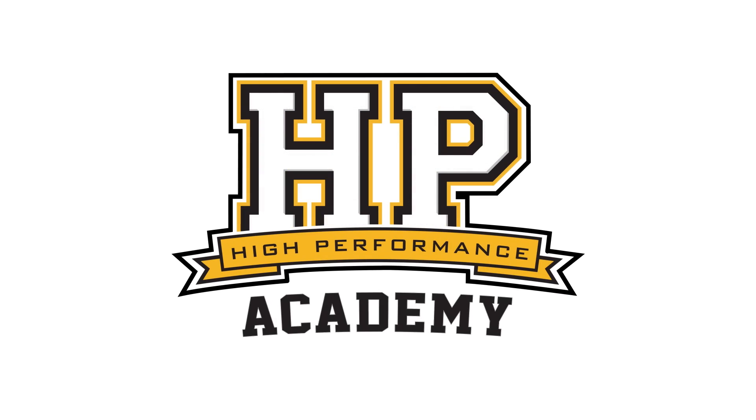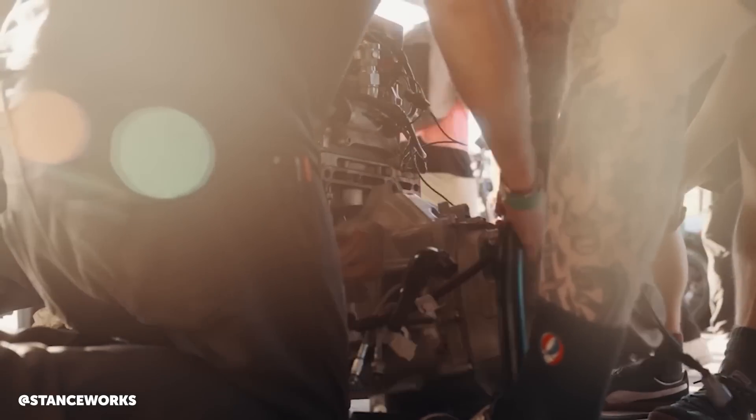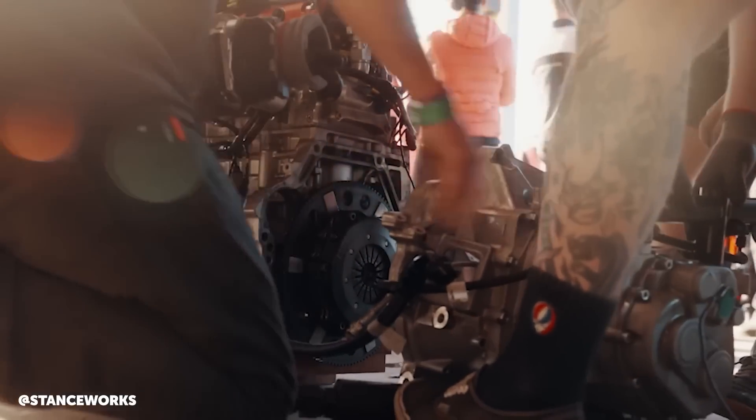Let's not worry too much about the specifics of the car — I'm interested in the gearbox control. So for a start, what is the gearbox fitted to the car? This has got a Quaife 5-speed dog box in it. It's got a load cell gear knob and a position sensor on the shift shaft so we know what gear it's in.